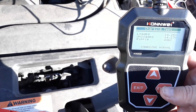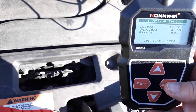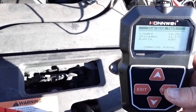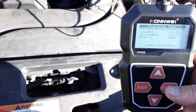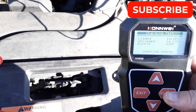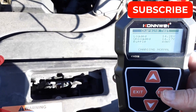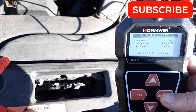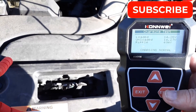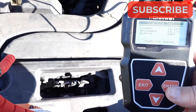Loaded and unloaded, that's normal. While the vehicle is running, you want your volts to stay around 14.2 — 13.5 is fine as well. If it goes over to 16 or 17 volts, that means your alternator is defective. If it stays at 12.5 with the engine on, especially with your lights on, that also means your alternator is bad.